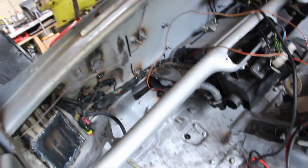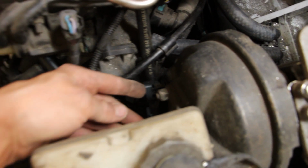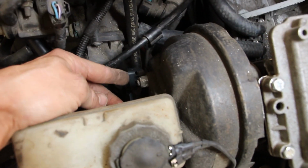A second matrix hose is also in. You can just sort of see it there. It goes under. It's a simple one. And while we're at it, we ordered the vacuum pipe, just while we're on pipes. There's actually a sensor on the Fords, which goes on the brake servo. It happens to fit beautifully on the mini servo. So really chuffed with that.